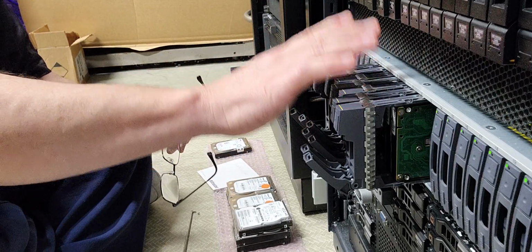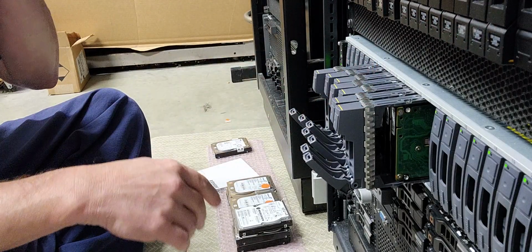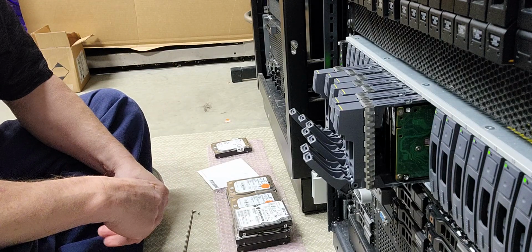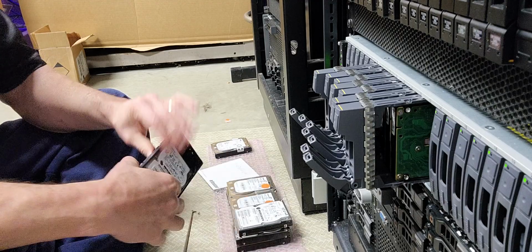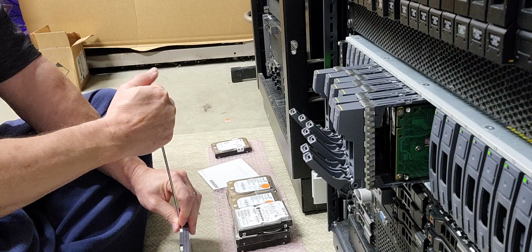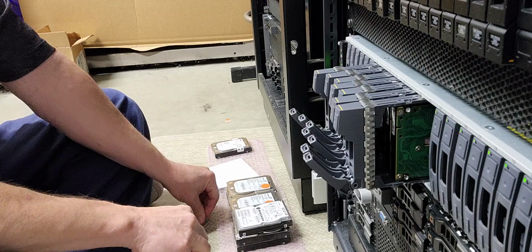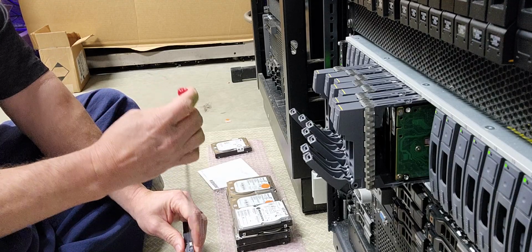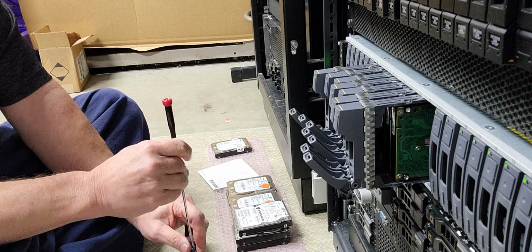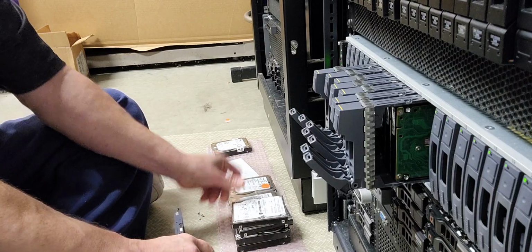It's HBA only, and that's it. A RAID controller, on the other hand, can be both. You can build your RAID groups as RAID zeros. Each individual disk is basically built as a RAID 0, and that allows you to have individual RAID groups for individual disks, and they're kind of treated like an HBA. But when you go into TrueNAS, all TrueNAS sees, just like it would with an HBA controller, is 24 disks, each individually typeclassed and ready to be deployed.